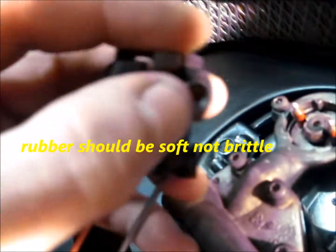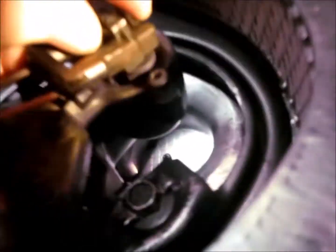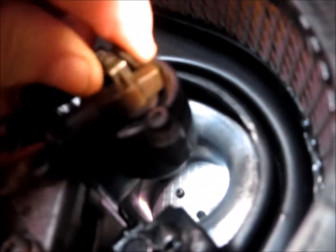These have a little rubber boot on the bottom of them. Just be careful if these are the original connectors for the fuel injectors — you just pinch them together and they come right off. And they just pop right down on top; you can hear them pop on there.